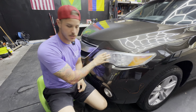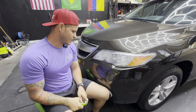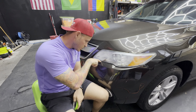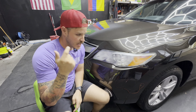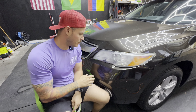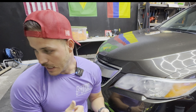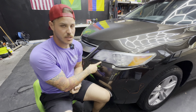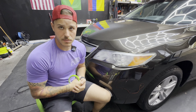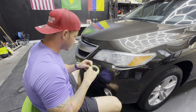Let's run through the process of what it takes to restore these headlights. Starting off: tape. This is essential because if you don't tape off these edges while wet sanding, polishing, or compounding, you're going to touch the edges with your pads or your wet sanding disc, and that can potentially harm your paint. So let's not harm the customer's car — tape things off, don't be lazy.